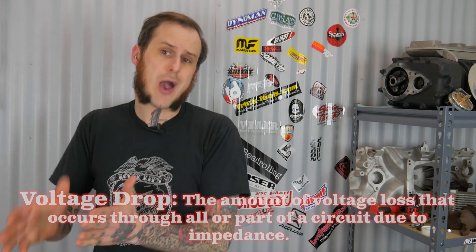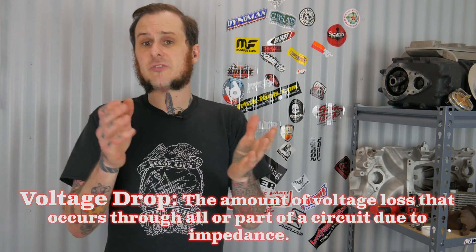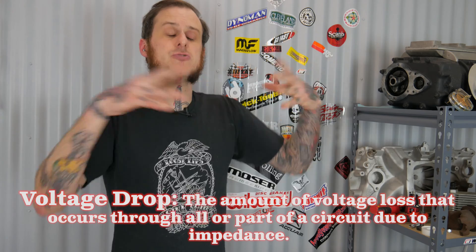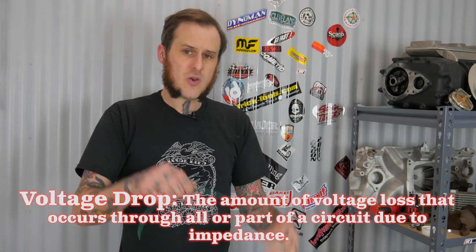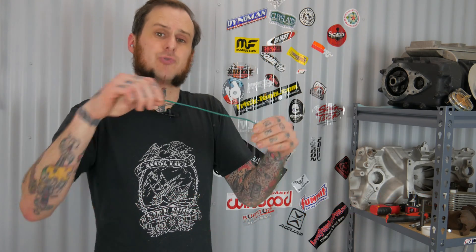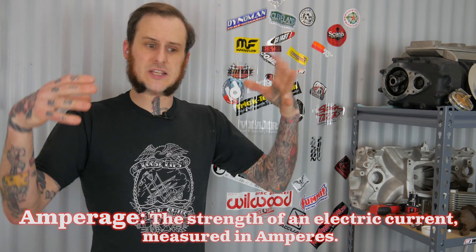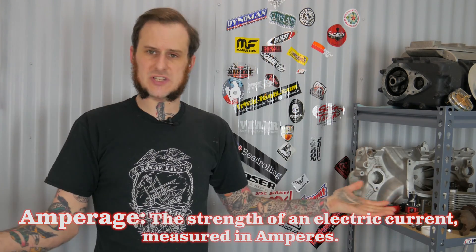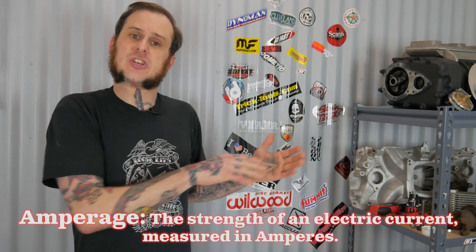Next, you need to understand voltage drop. A voltage drop is the loss of voltage over a circuit. This can come in the form of a load — a light bulb, a fuel pump — they are using voltage so they are dropping voltage. But wire can also be a voltage drop; you can also drop voltage in a wire. The third thing you need to understand is amperage. It is current — the actual load, device, whatever is in that circuit, how much amperage it is using, or wattage depending on what information you have. You can figure out amperage based off of wattage and voltage, and we'll get to that a little later in the video.